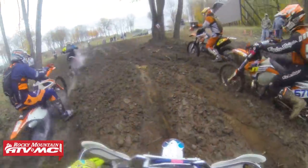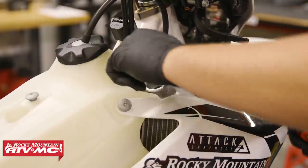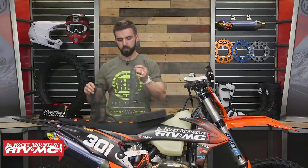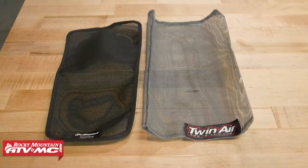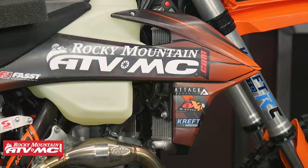When it comes to overheating, this is commonly overlooked but very important. In a long race, if your bike overheats, you're going to DNF — and that's a bad day. A couple of things you can do: first, a high-pressure radiator cap, which helps prevent your coolant from boiling over sooner. Also, keeping mud out of your radiators is key. You can get radiator guards — we have ones from Bulletproof on this KTM — or Twin Air and Polisport make radiator sleeves that slide right over your radiators: a fine mesh that still allows airflow but prevents mud from packing in. You can also get a radiator fan kit that mounts to the back of your radiator and automatically kicks on when your engine temp reaches a certain temperature — these do a great job of keeping temps down. Lastly, you can run the Super Cooler from Boyesen, which promotes better coolant flow through your engine for more cooling.